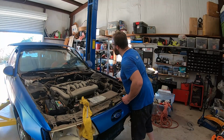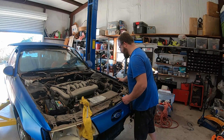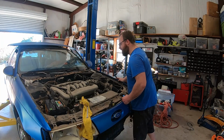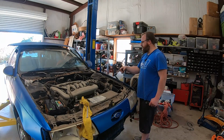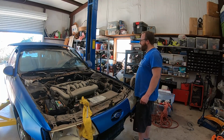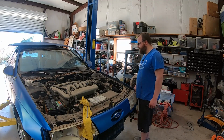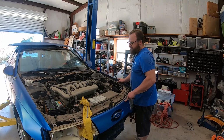I think it sounds worse inside than it does out here. What you're hearing in the back is the muffler rattling. Okay, I noticed that when I was coming in. And I hear that sound like the starter kind of grinding at the end of it when you let it off and the Bendix pulls it back. Maybe it's getting bad or it's just corroded, or bearings in the starter are grinding a little bit. Or maybe you're just being paranoid. Yeah, maybe. All right, well, that's really cool.